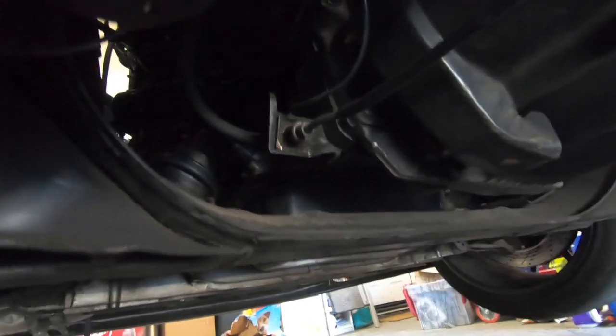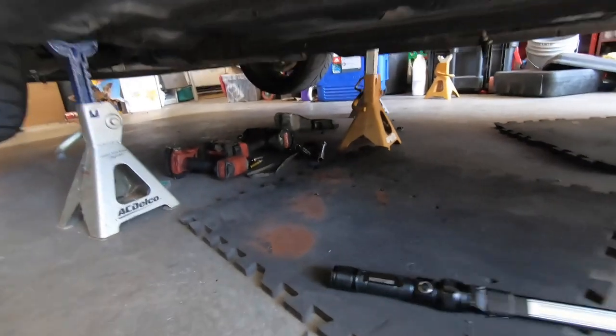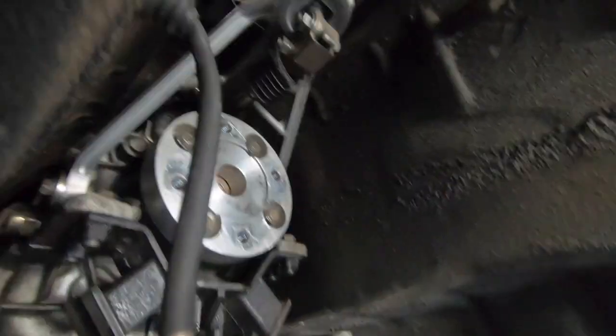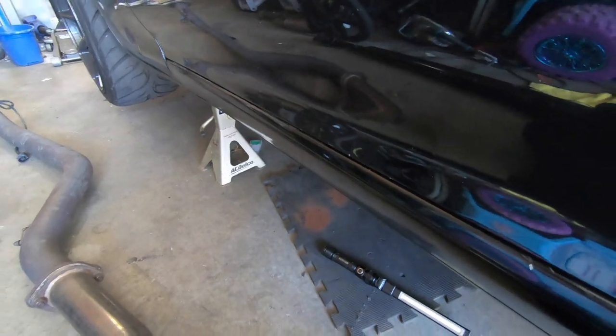The slave cylinder is right there. I just have to loosen that line with a line wrench, and then loosen the seven or eight bolts on the transmission — some are 17mm, some are 14mm. The two top ones are a pain. I'm not sure if I need to remove that little tripod up there; I took it off last time but I'm going to try to do it without removing it this time.